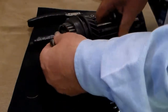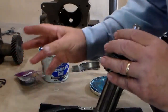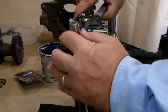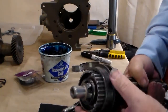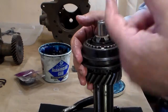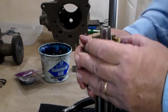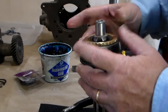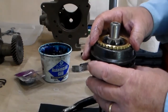If you have seen the rest of the videos, you will know that snap rings are my nemesis. That one is installed. Now all that assembly is on. Do not pull the sleeve out too far, because you can pull it all the way out and the springs will snap off — there is nothing holding it on there. What holds it in place is going to be the rest of the transmission. You will have your blocking ring on, lubed and ready to go.